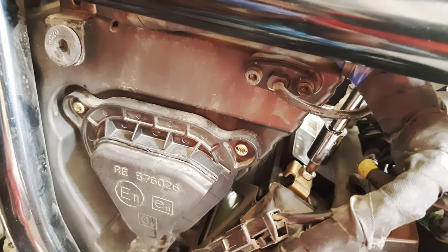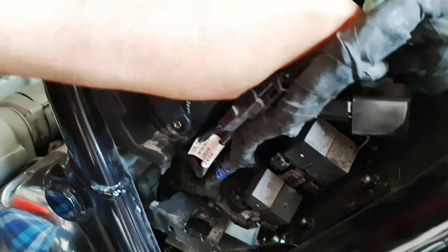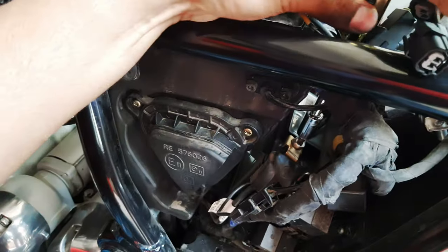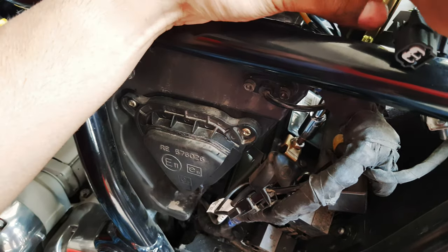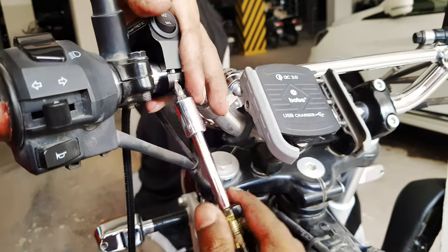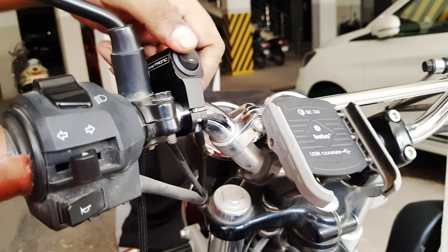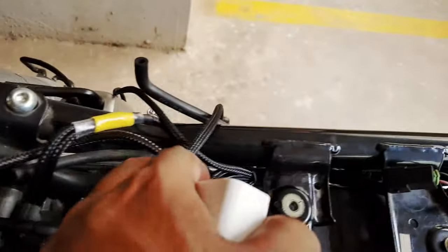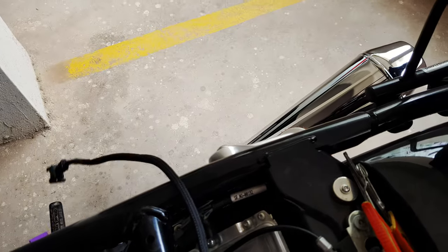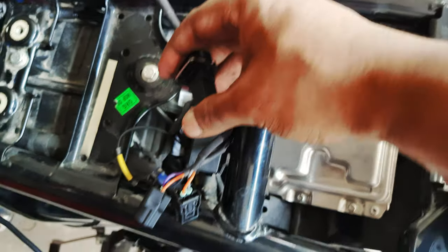And now it's time to connect the ground wire from the Powertronic to the battery's negative terminal. I forgot to show you the reconnection of the ignition modulators. I basically had to place them over the battery and get them connected to the points on the harness. That's the map selection switch. Pretty straightforward. Here you can see me connecting the switch to the harness, but of course I had to redo that to make sure that the cable was tucked in neatly inside the frame.